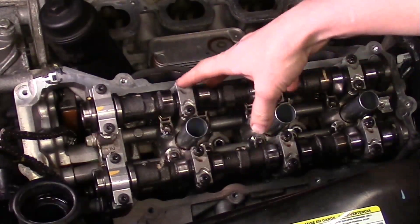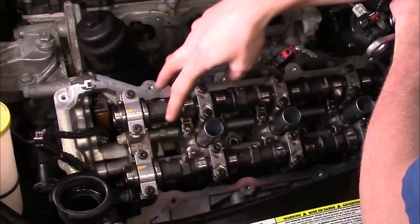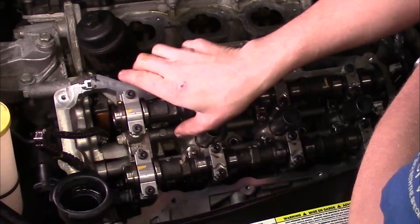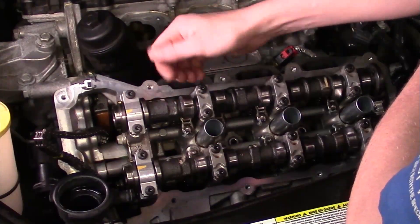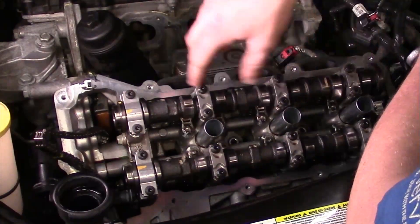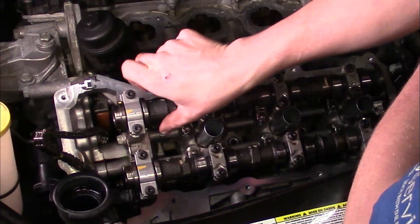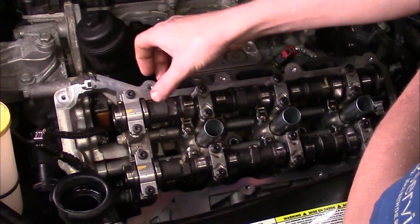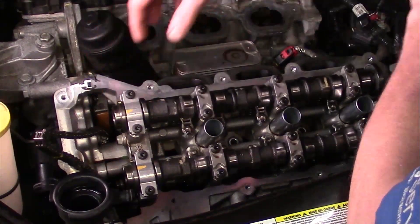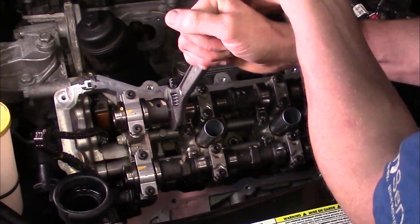So when you go to reinstall the camshafts, we're going to do the same way. The four dots we're using for quick reference for lining up the camshafts — once the cams are in their relaxed state, they'll be pointing pretty much straight up as far as with the vehicle, not towards the center of the head. You just rotate it towards the intake, and when you go back to reinstall it, you do the same thing. Sit it there, and when you get ready to put everything on, rotate it back to the position where all your marks lined up.